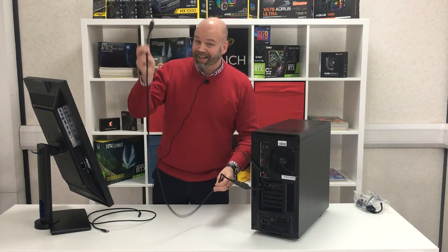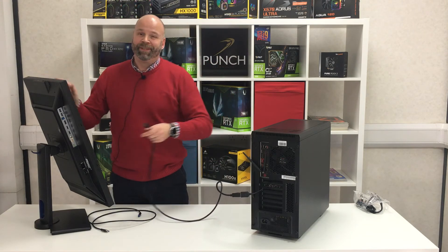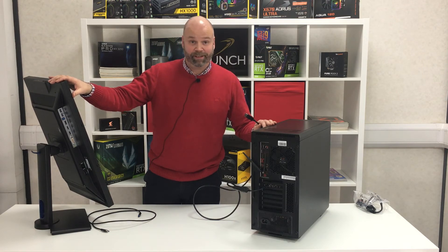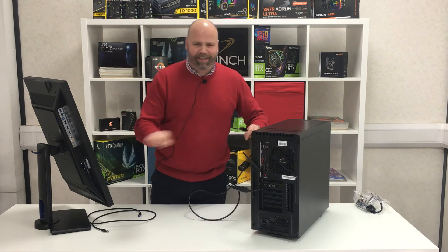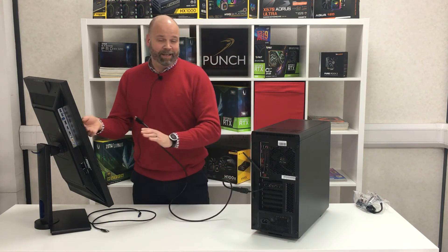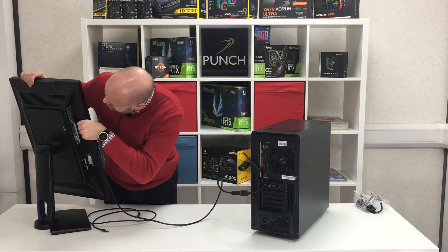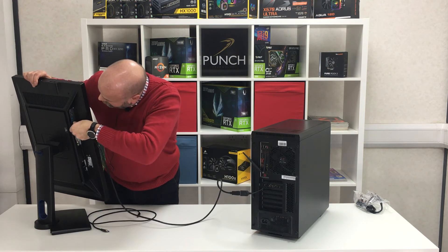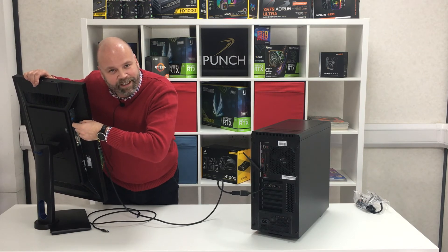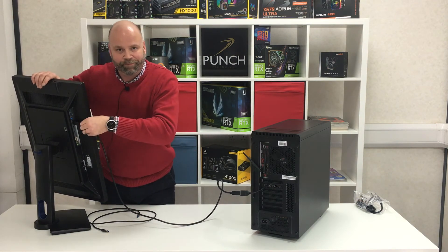Here's another common misstep — you only need one connector cable for the signal to go between your PC and your monitor. What we find is because BenQ monitors come with several different cables, people unpack all of them, connect all the cables up, and then call us saying they're not getting a signal. Even if they've got the graphics card connection right, if you've got more than one connector plugged in, it's not going to work properly. DisplayPort in — they've got little clips on these so they don't just pull out, but once they're in they're nice and secure.